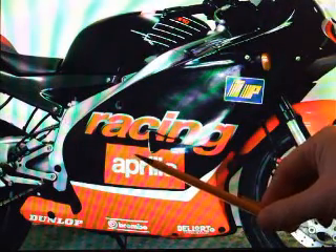That picture there is to show that the fairing has got WD-40 on it — it kind of looks a bit slimy, but the bike will clean up a fair bit better than what it looks like at the moment. You can also see in some of these pictures there's a screw missing and there's a little crack in the fairing. You can see where the bike has fallen over — there are marks in there. The panels generally speaking are not held on very securely; screws are missing and that sort of thing. As a quick measure you could hold it on with cable ties, but you will need to replace the bolts and screws, which are not with the bike — they've vibrated out and got lost. Motoparts UK is again a good place to get bits and pieces for that.